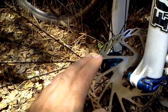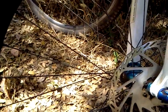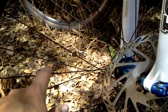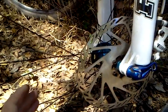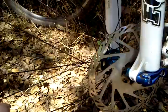Now if you see wheels for sale and you see a wheel set for sale, those are two different things. You've got your wheels, and sometimes they'll include the spokes and sometimes not. But then you have your axle. A wheel set is your wheel, your spokes, and your hub set. That helps knowing when you're trying to buy something, because if you're expecting a whole wheel set and you're just getting the wheels, that can be an expensive mistake.